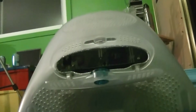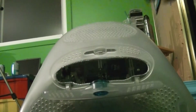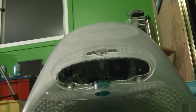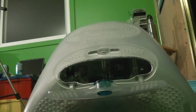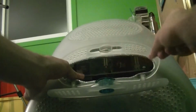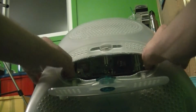Fortunately, I don't know how well I can get a shot of this. Maybe well, maybe not. Take the old memory out. Grab the new memory, open up the new memory if need be. Take the memory out of the slot, and attempt to insert it into the iMac for the first time. And potentially, nope, it will fit.